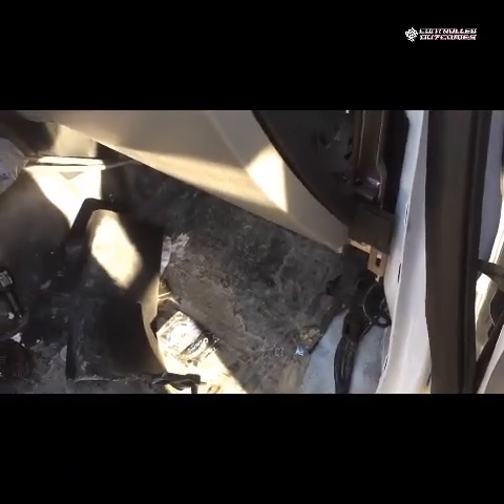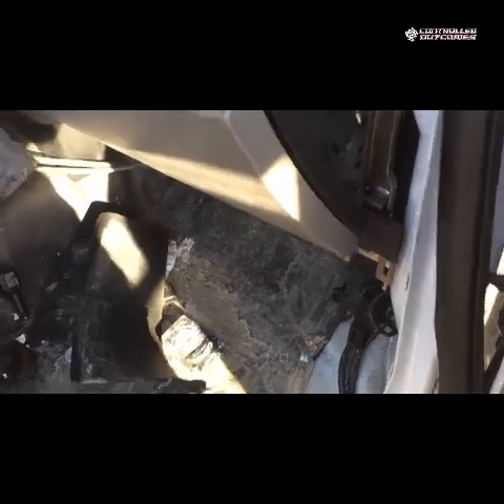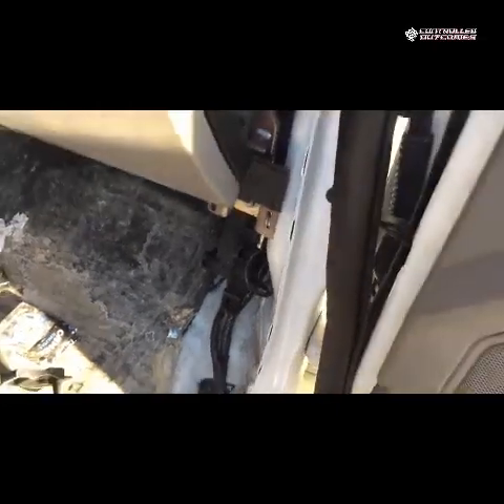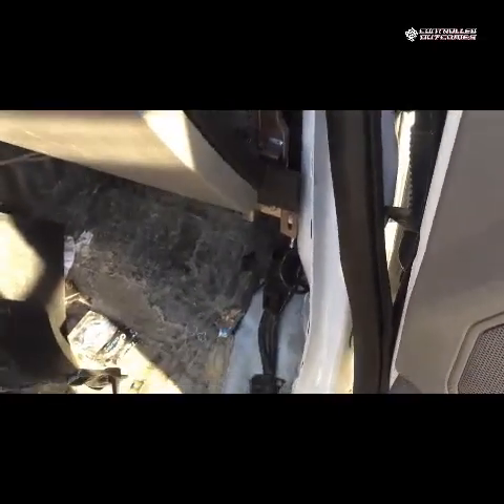You'll do the poke-and-wrap on your constant and your ignition — it will not affect the vehicle at all. Your ground will go into the side down here, or you could ring-terminal up here if you wanted to. Completely up to you. That's how you do a three-wire on any of the newer Ford pickup trucks.